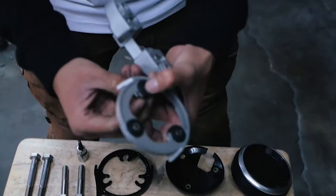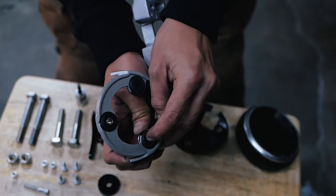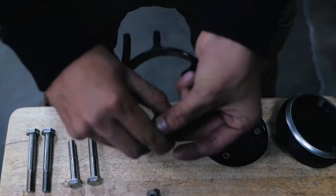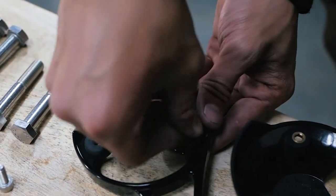We need to push these out. You're going to use the rubber grommets — the factory ones. Just push on the back side; you could use a flat head, just kind of roll them out. Take these, roll them in. You can put some WD on this and then press it in.